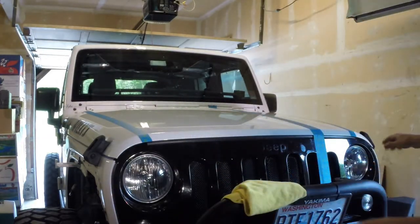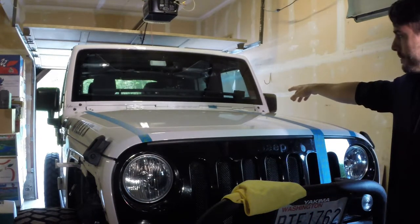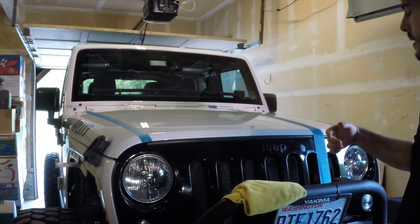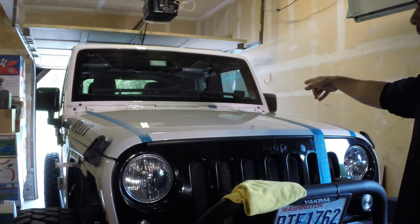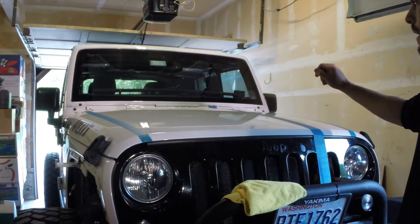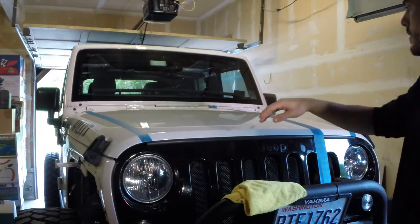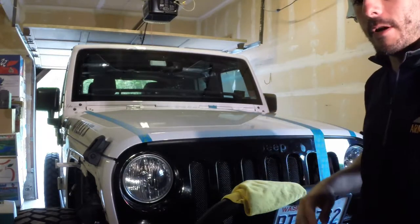What I'm going to do is cut here and also up between the cowl and the hood. Then I'm going to remove the cowl tray, remove the grill, do the reverse masking on the grill, clay bar the cowl tray, and paint both the grill and cowl tray off the vehicle. Then I'll paint the hood up here. I need a T30 Torx bit to go ahead and remove the cowl tray. The reason I left everything bolted down is so the paint lines match up when I reinstall the cowl tray.